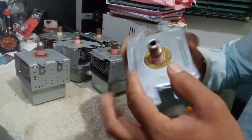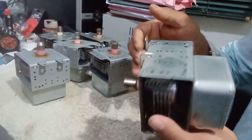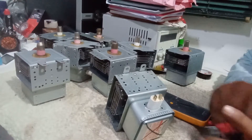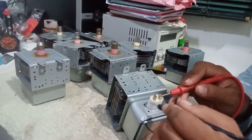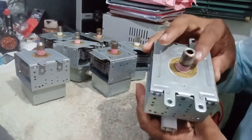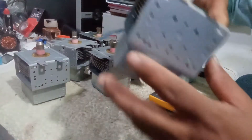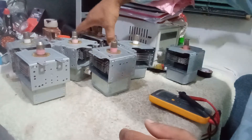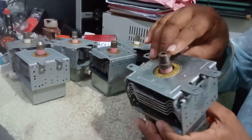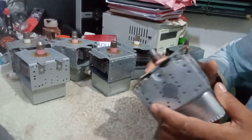The first way is to check by eyes. See, can you see it's black? This knob is black, so that means it's spoiled — it's burned. No need to check by meter. And I have one more — this one is also burned. See, fully black, fully burned. If you use this in the microwave, it will spark.